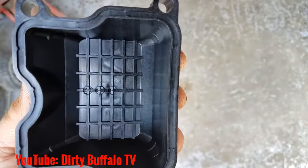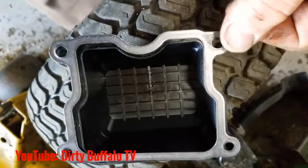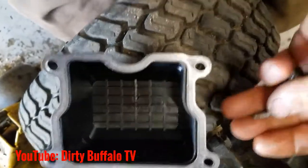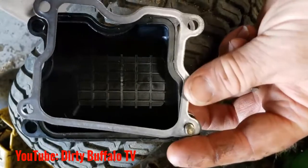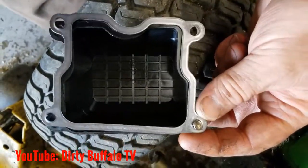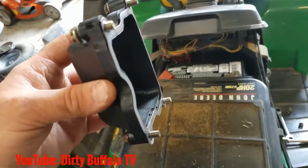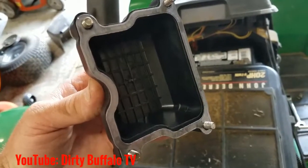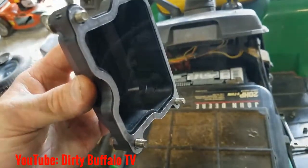Just leave the o-ring out, put the gasket in there, and you're good to go. Take your new valve cover with no o-ring, gasket lined up, put one of your screws up through in one corner and another in the other corner, and put it back on the cylinder. The fact you can put this on with the bolt started through there lines everything up perfectly — you don't have to worry about that o-ring falling out, getting pinched or cut. Just put the gasket on and it goes right into place.